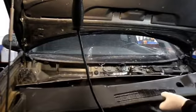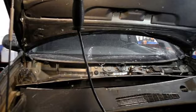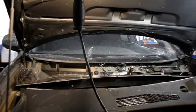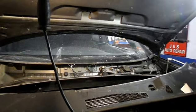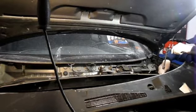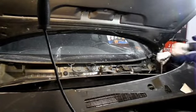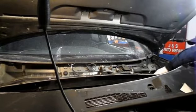You just lift this right out of the way. We're not going to go far with it — we're just going to take these bolts out up in the front there. If you've got air, you can use air. If you don't have air, you can do them by hand also. What I normally do is remove two of the nuts and leave one of them holding the strut to the body of the car. Don't lose these nuts — you're going to need them again to put it back together.